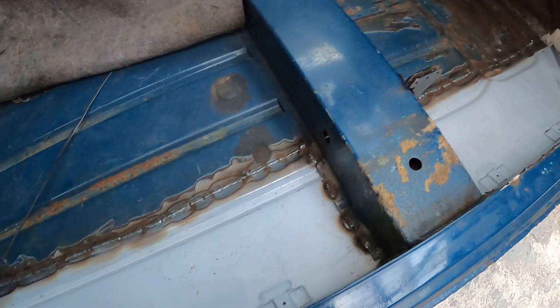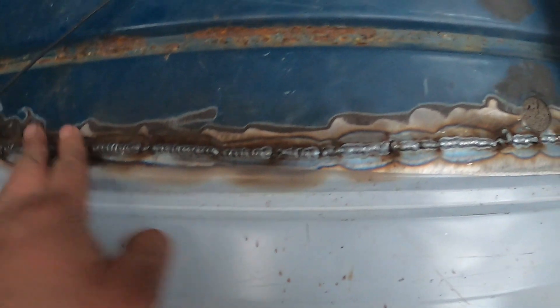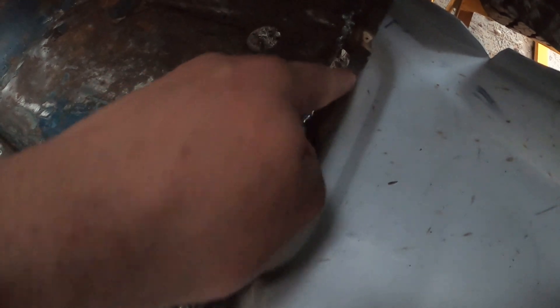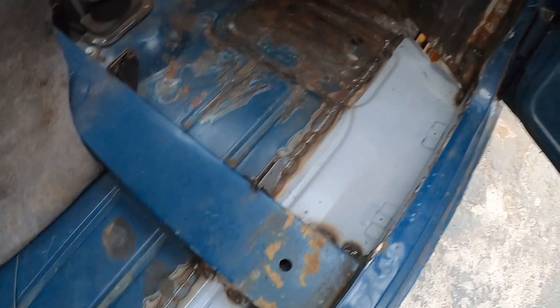Alright, so that's all the welding done to get the floor in. You can see I've done a tack and then a seam — I'm really happy the welding's done really well. Obviously you need to finish it back, which we're going to crack onto next. We've done the repair a bit further up there as well — a bit extra, but obviously we'll grind that back. It's covered by the battery box anyway. And then I'll make that circle again and join that together so it looks kind of factory. Hopefully I can get it finished back nicely.